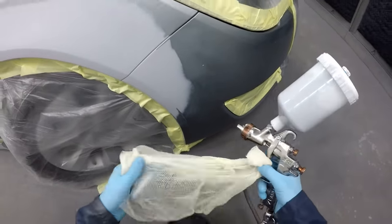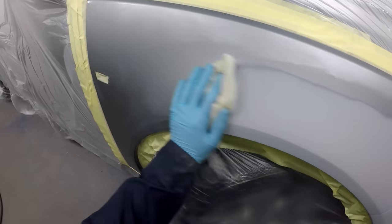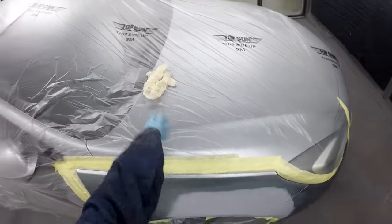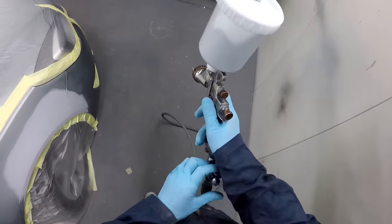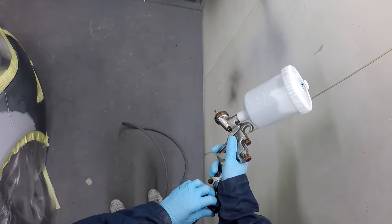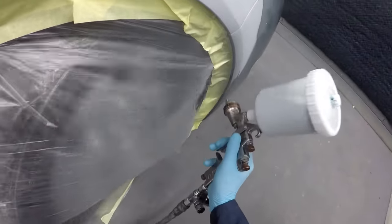With the clear coat we're running two bar of pressure, and any dust near this car can move around, so I airline around the front end and the floor to make sure there's no settled dust. I also go over the wing and the masking around the area. During the paint job I will tack all the blend areas to keep them clean and free from overspray, and tack over the repaired area after drying it down — making sure anything landing on the car is being taken off between coats.